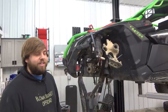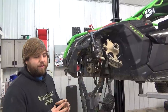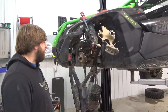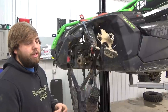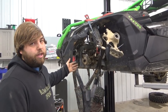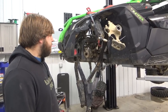I like to think I have pretty decent throttle control, but all that said, it's not a true lock diff even when it wasn't broke. If it was like a true lock diff, it probably would have played into which way I was going to fix this, but the fact that I want four-wheel drive when I hit the four-wheel drive button was a big part of it. So we blew the spider gears the first time it broke, then we pulled the diff apart, split the cases and welded the spider gears — we didn't really show any of that, it was just time crunch and frustration. Got the spider gears welded, put it back in, and then broke something inside the diff again — I think it was the welds or another spider gear, something disintegrated inside there.